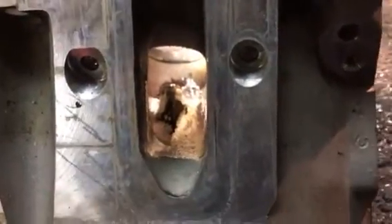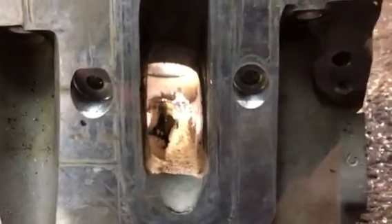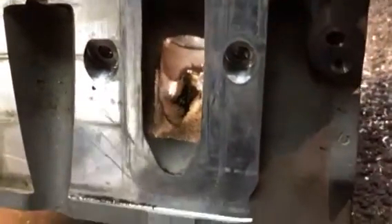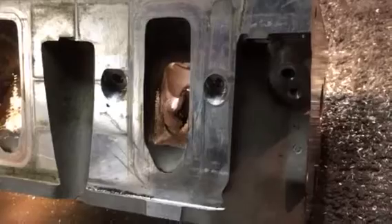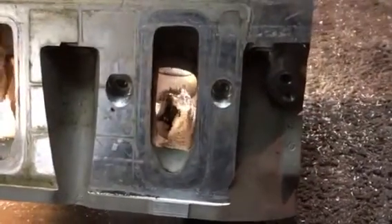The short side is widened, the entire guide boss has been narrowed. Keep in mind this is still in the rough to medium cut stage, so it'll look pretty when I'm done. But if you look at the difference it makes - removing that rocker bolt bump really opens that left side of that port up tremendously.